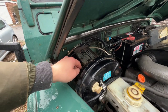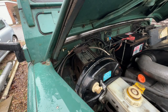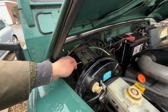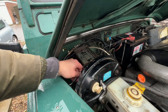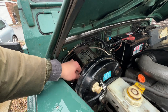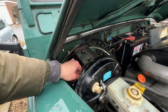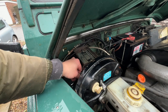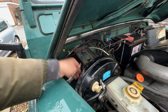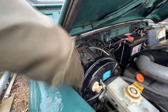I suspect the rod is within this box here at the back of the vacuum servo. Interestingly, you can see the VIN plate here. There are four bolts at the back of here, which I believe are half inch, so I'm going to use a 13 because nothing else I have is really imperial apart from maybe the Rolls-Royce — and the Rolls-Royce is not something I'm often working on myself. I did spray a bit of lubricant and penetrating oil on these the other day so they should come loose. This is going to take some time, so maybe some gratuitous time-lapse.